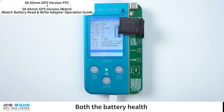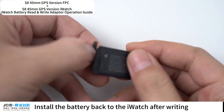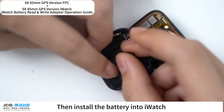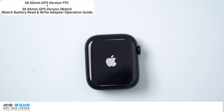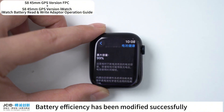After activation, click next to find health and modify the data to the required battery efficiency. Write — both battery health and cycle count can be modified freely. Before installation, fold the repair FPC to the same shape as shown in the video to facilitate the process, then install the battery into the iWatch. Boot up and check battery efficiency — battery efficiency has been modified successfully.